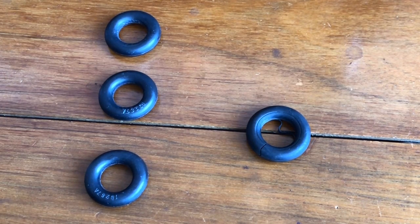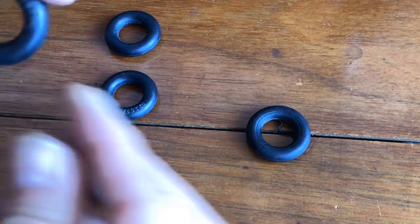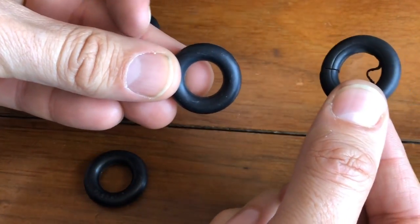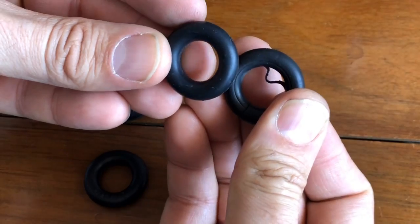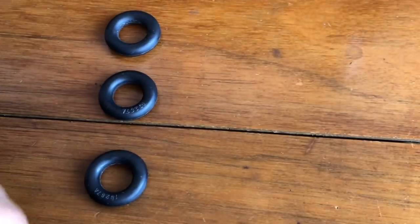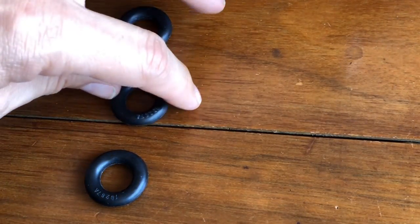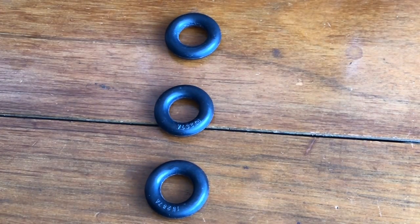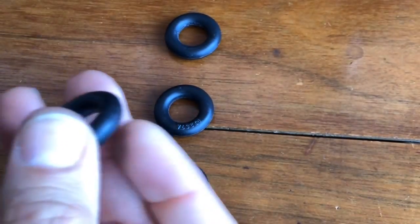There's a reason I sometimes order larger sizes. Some of the Berninas take an even larger size, and then these rotaries will vary. Okay, now I've got one. Here's a new one. It looks like it's lining up fairly well, and again, it's going to be more flexible than the old one. Typically, for a lot of machines, there's a small, a medium, and a large size that I can get at my supplier. You may have to go other places online. As we go forward in time, the European companies started this first, and now all companies today have their own special tires, and they're very proprietary now.